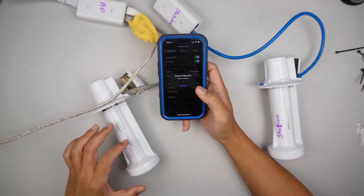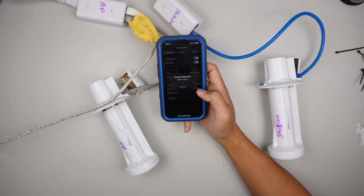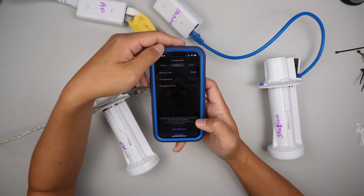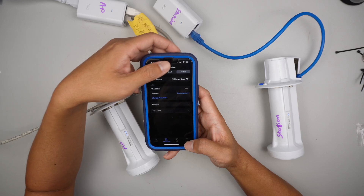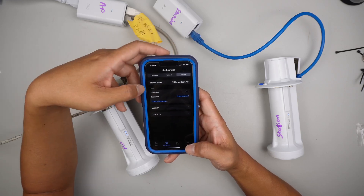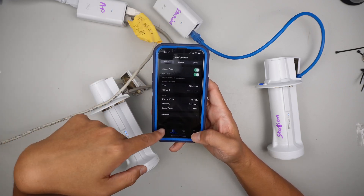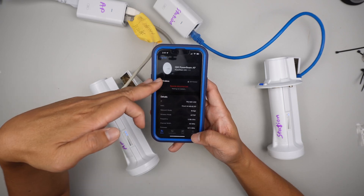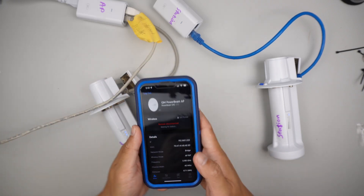Right now it's doing the configuration — we just have to wait until it's set up. Configuration is set. Click on network, not now. It's going to be bridge mode and that is the system. I recommend changing the UBNT password but for now just leave it. Now we have the access point set up, and it says remote disconnected, meaning the station is not configured yet.